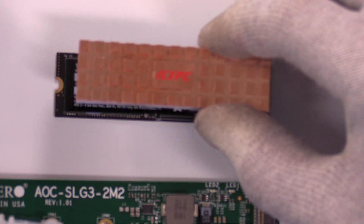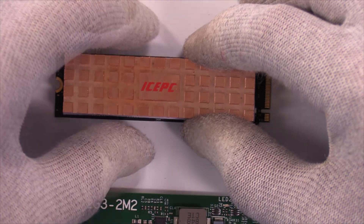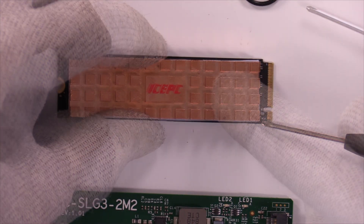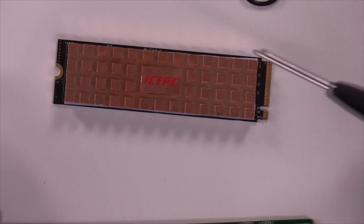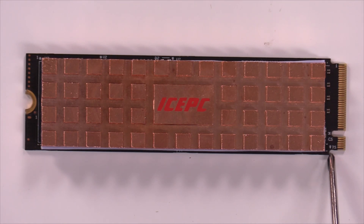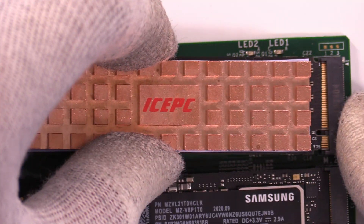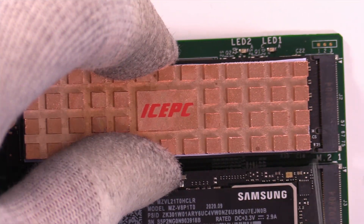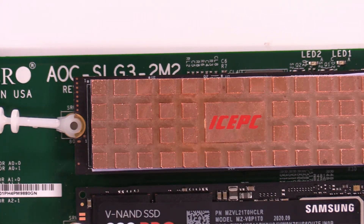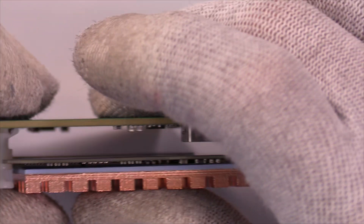Place the drive down, put the heat sink on top, watching the connector on each end for the notch. I'm clear on both ends. I like the length on this one better. Put that on the card, slide that in — perfect. Clear that connector notch, come down on this end, clear that bushing, drop that pin in, and we're good. Clearance is good.